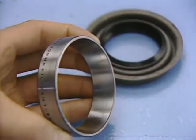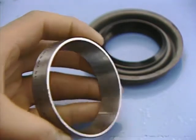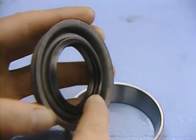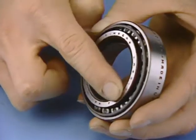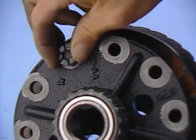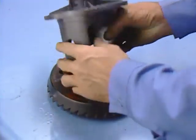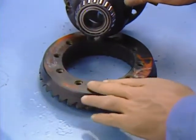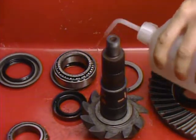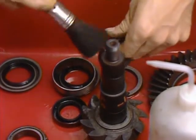With the pinion out, inspect the rear bearing cups for galling or other damage and check the oil seal. If the bearing cups or seals need replacement, refer to the appropriate shop manual for procedures. Rotate the front cone and roller with hand pressure to check for roughness and replace it if necessary. Disassemble the differential for washing and inspection. When removing the ring gear, check the bolt torque and look for any dirt between the gear and its mounting face that might have caused excessive run-out. Wash all the parts thoroughly in new solvent so you can see all the surfaces clearly, and then oil the bearings to prevent rust.